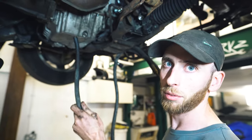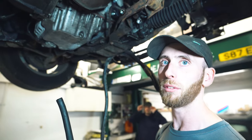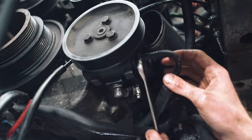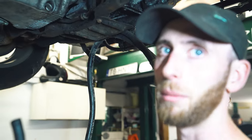Thank you very much. I'm trying to get the power steering lines working from the rack to the pump and the pump to the reservoir. Turns out after some pipe removing that the banjos are the same on the rack for the Volvo as they are on the rack that is for the E46. I'm just trying to use the original E46 lines and one of the Volvo lines and modify them a bit, and hopefully it should all bolt up. After that, need to measure up for the prop probably.